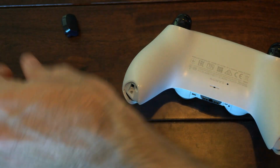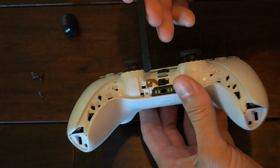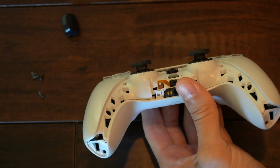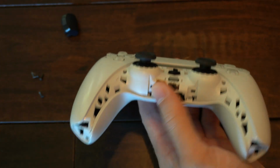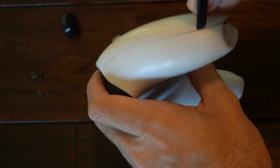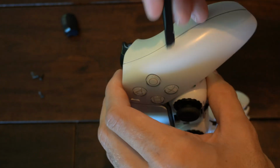and the back cover is relatively easy to remove also. So got all 4 of them out. Now flip it over here. Look at the headphone jack. There should be 2 latches, one here and here. Just simply create a little bit of separation in here with your tool, or even a guitar pick if you have one laying around. Put it in the space right here and create some separation. Then go to the side here. Once those latches are unlatched, create some separation right here and just pop open any of the latches on here. Just like this. And then you should hear a pop.